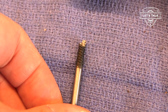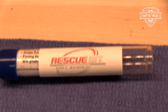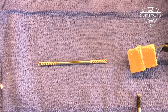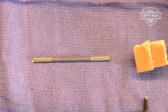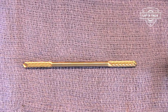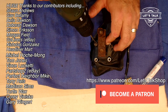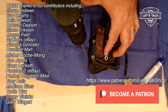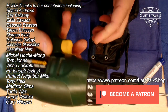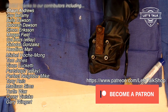The screw extractor snapped. What now? Rescue bit. Rescue bit comes with a bit on both ends, so even if you've worn one out, you can just switch sides. So with a broken bolt here on the wiper motor, I'm gonna use the rescue bit to try to bail my ass out of this thing. So with the lack of control of a handheld device, I might be better with a drill press, but I don't have one, so...